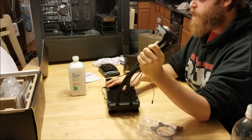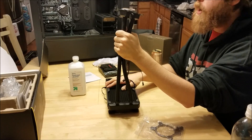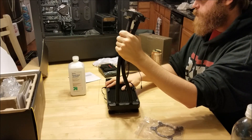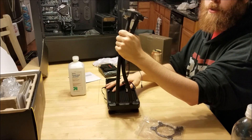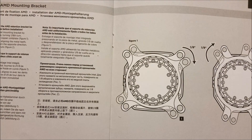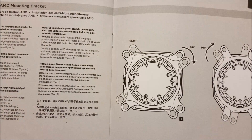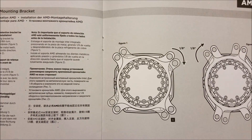My problem with this is that the instructions for the original Intel bracket removal were not very clear inside the instruction booklet. I'm going to go ahead and pop that up right now with a clip of me showing you the instruction page. According to the manual on this Corsair H115i, you remove the integrated Intel mounting bracket by pushing on the metal piece and turning it an eighth turn. It also says to see Figure 1 for that, which shows turning it clockwise.